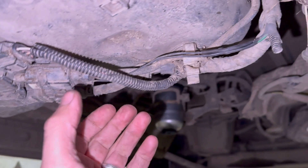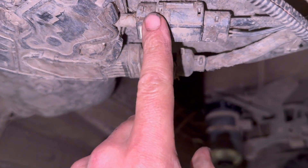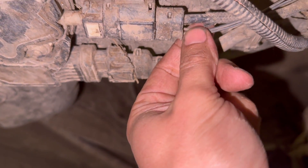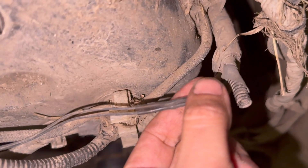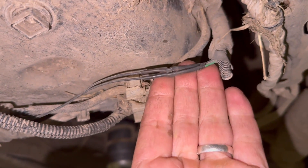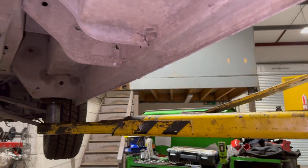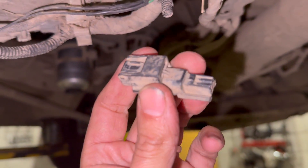The actual reductant heater two — the inline heater — this is the connector for the AdBlue pipe. You can see we've got two wires in there. It runs to a connector there, and that's where we had the problem on this one. The wire had been snagged, the wires were damaged a bit, and then they'd rotted out. I'll just show you the connector.